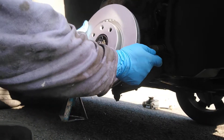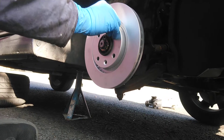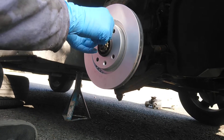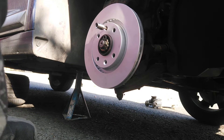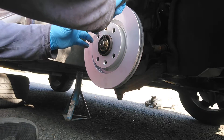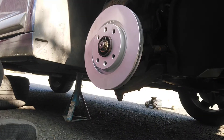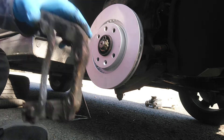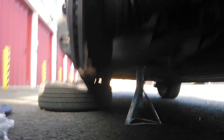We're going to put it back together and I'm going to continue filming — it shouldn't take too long. I'll probably get two new screws because the head on this one isn't great either. The disc doesn't need to be too tight, just kind of finger-tight is fine. I'm going to start building the caliper back up. I'm going to move the camera around so you've got a better view.